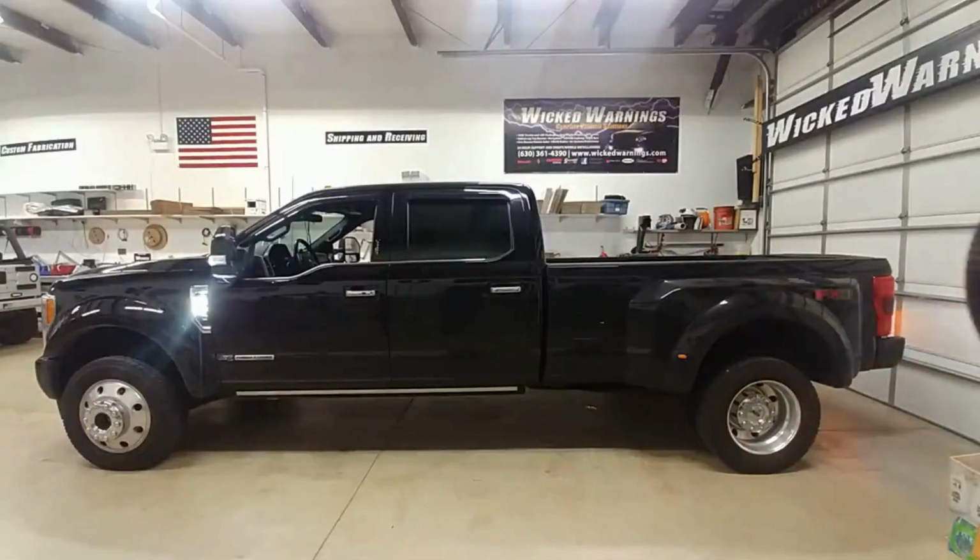Of course, we integrated our flood feature into this build like we always do. We've got the forward-facing white mirrors, the badges on the side. We've got the reverse and the cargo light all set up on a white flood switch. With or without warning, you can flood and get that white light. The flashing does not have to be on, but as you see, the flood white will always override any flashing. So if your white flashing is on and you flood white, your white flashing is going to stop.